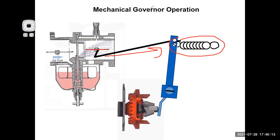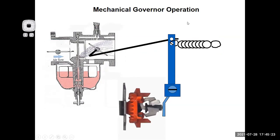You pull the rope, right? You fire up your engine, you get it running. And when that happens, this assembly here at the bottom starts turning. So this guy starts spinning. As he starts spinning, the flyweights begin to move out. As the flyweights begin to move out, the governor cup ends up pressing on the governor lever that's inside the engine. That lever then feeds outside the engine, where it can work this lever arm on the outside here and ultimately start closing the throttle.